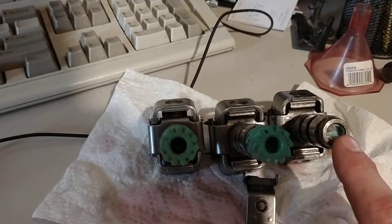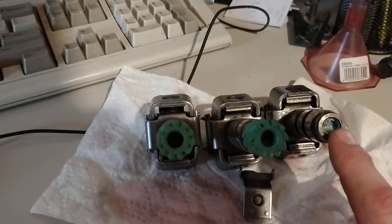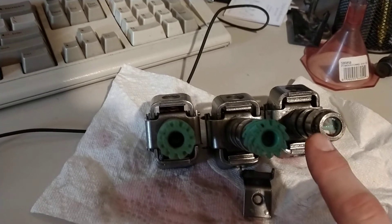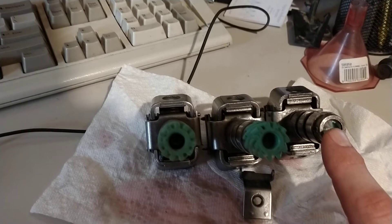It was quite stuck — I don't know why. I've never had that happen before. I've done three or four of these in my day, so it's just kind of weird and annoying. I guess I should be thankful that the bore wasn't stuck, which would have been a lot worse, because I would have had to have the case bushed.